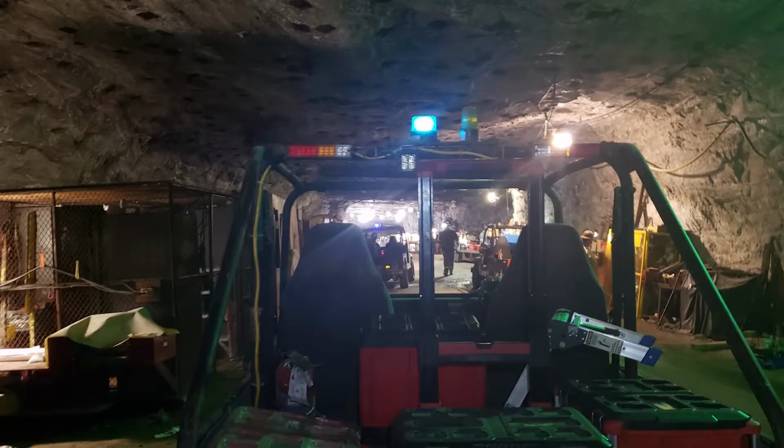So what does that tell you? Usually that's going to be a bad ground. It could be a bad power supply somewhere, but we have definitely a voltage drop somewhere. My big challenge down there is I don't have every diagram printed up for this vehicle, so I don't have a way of looking stuff up. I started to investigate some grounds and poking around, and then we got the evacuation light. So we had to get out of there.